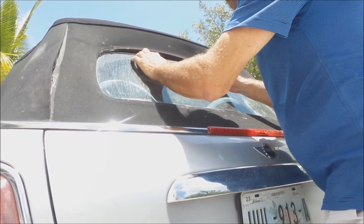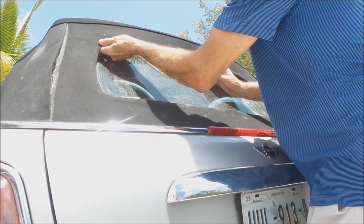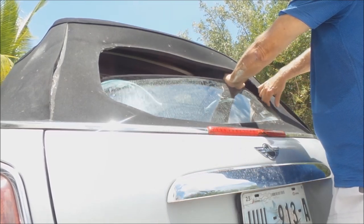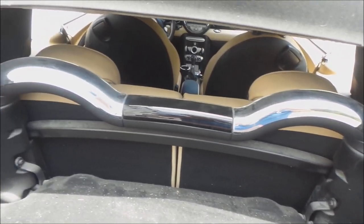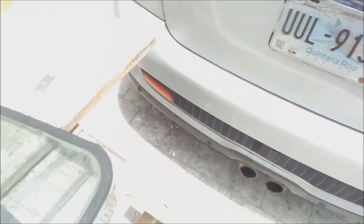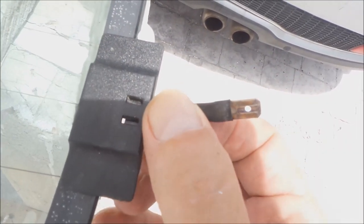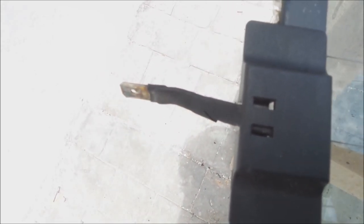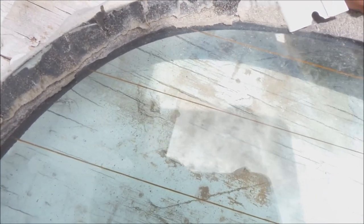The first thing I want to do is remove this window. I see a lot of people on the internet using masking tape at this point, but I don't even need the razor — this is so easy to pop out. I successfully got the window out. On this 2010 Mini Cooper it was pretty easy on both sides to remove this little plug — it basically just pulled out, exactly the same on the other side. Pretty easy to reinstall the electric portion of the window. Let's clean this up with some Windex and I'm going to scrape all of this old silicone off with my razor blade.